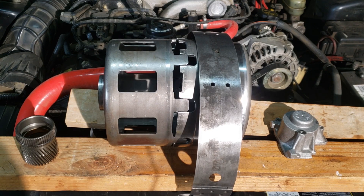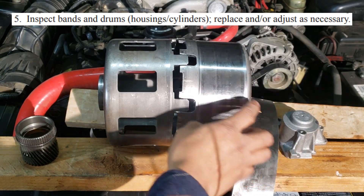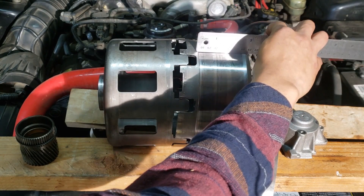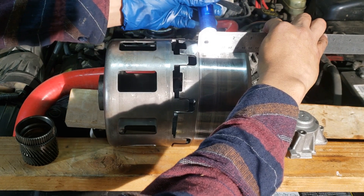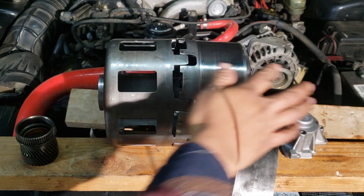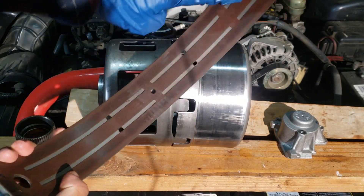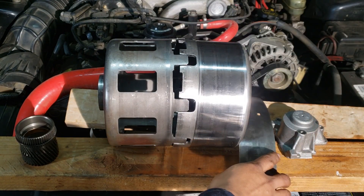You can air test a servo similar to a clutch pack — just find its fluid passage. The drum is measured for wear on the band contact area by placing a straight edge and shining some light — no light should be able to pass by. The friction material on the band is inspected similarly to how you inspect the friction discs in a clutch pack.